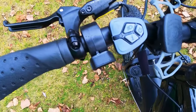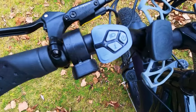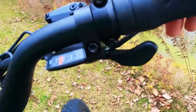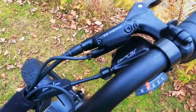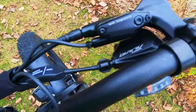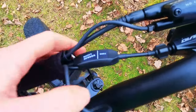One thing that's really unique about this electric bike compared to many mid-drive electric bikes is you do get a throttle — in this instance, a left-hand thumb throttle. On the right side, a nine-speed drivetrain using Shimano Alivio with a trigger shifter, which I personally prefer compared to the very entry-level thumb shifters. Alivio is a step up on the Shimano hierarchy. Attached right to the shifter is the shift sensor, which cuts power to the motor immediately as you shift, preventing unnecessary wear on the drivetrain — an important component on mid-drive electric bikes.